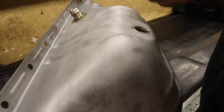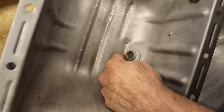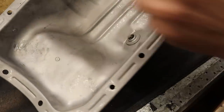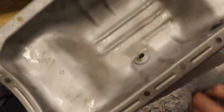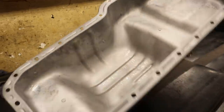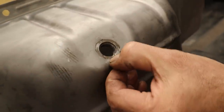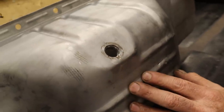Toyota puts a nice little divot there at the bottom, and it's actually intentional to get every little bit of oil out of this pan. So there's a little hole in there that you can see from down there. So when you pull the drain plug, it actually gets every little drop of dirty oil out of it. But that being said, that little divot there gets low, and then you have an oil leak right there. Someone over-torqued this and reused the gasket a bunch of times.